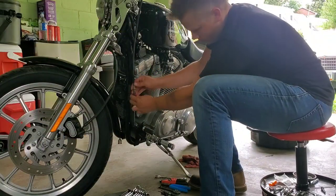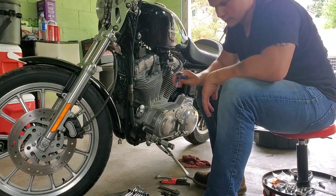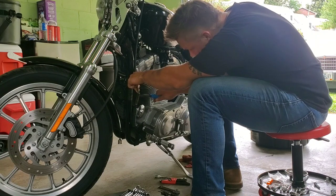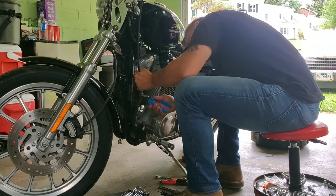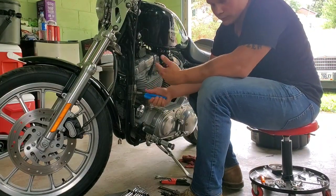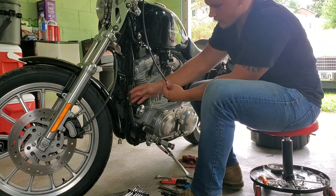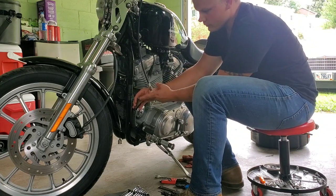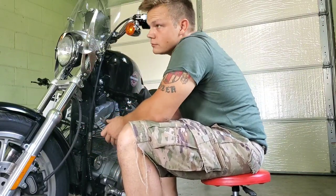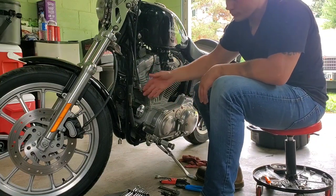Because my clutch cable is broken and I can't take the slack out that way, I'm actually just going to cut my clutch cable with a pair of dikes to get the slack I need up here. You can honestly do this either way if you're replacing your cable, since you're not going to reuse it. My cable seized up and snapped when I was trying to make an adjustment. Whatever reason you're replacing yours, if you're not going to use it again, you can just cut it.